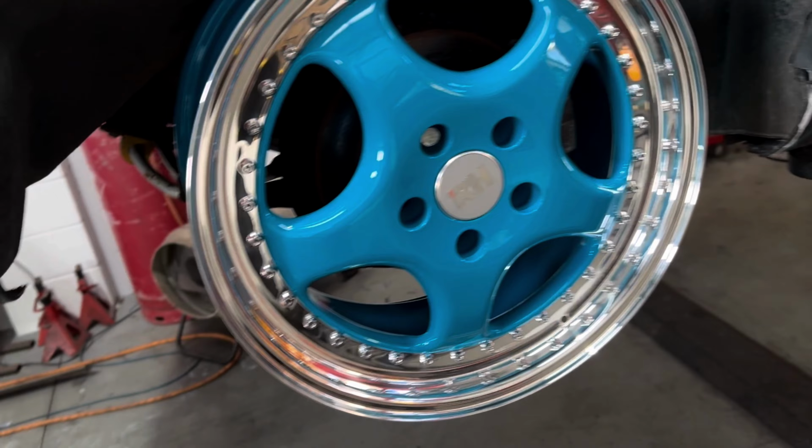Right, the next thing we're going to be doing is clamping the brake line so we don't lose any fluid when we remove the caliper. Now obviously this has lost all its fluid anyway, so I don't particularly need to be doing this. It's just for reference and showing you how to do it. Right, now we're all loose, we're ready to remove the caliper from the brake line, or the brake line from the caliper, whatever way you look at it. So it spins anti-clockwise, and that's lefty-loosey. You should know that. Next, we're removing the handbrake cable from the receiver. To do this is quite easy. You just put a bar in and pry it, and then pop the ball joint out of the little slot that it sits in just there.